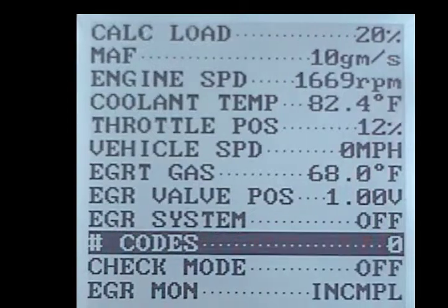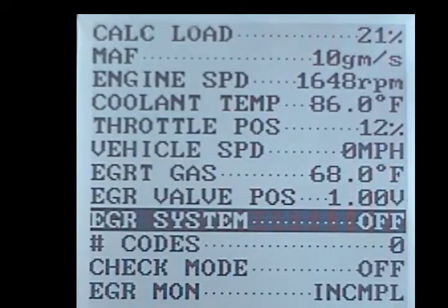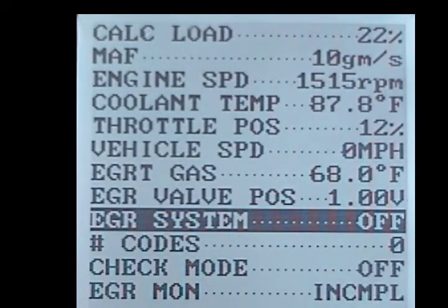When this one turns on, this will increase if the vacuum gets to the valve, and this will increase if the temperature is rising because the EGR is flowing. If it's happy in the end, this will switch to complete. He's going to drop it in drive and go for it. I'm going to turn the fan on just low for airflow. Drop it in drive, going up to 55.